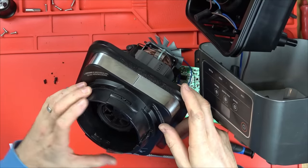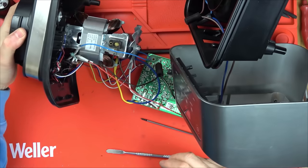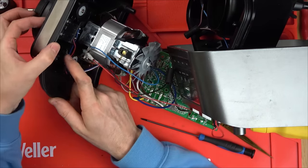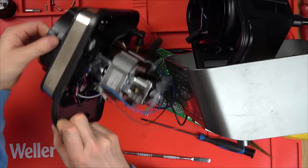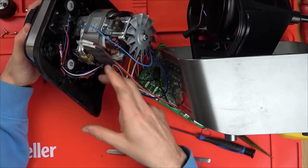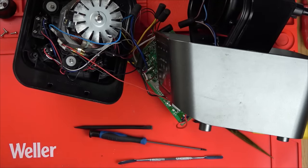For those that like to play along at home - see if you can spot what the problem is before I can. It is fairly obvious when you look closely. So these are all the micro switches - four of them, two small ones at the front here. So before we worry about that thermal fuse type thing, let's just make sure the micro switches are actually working.